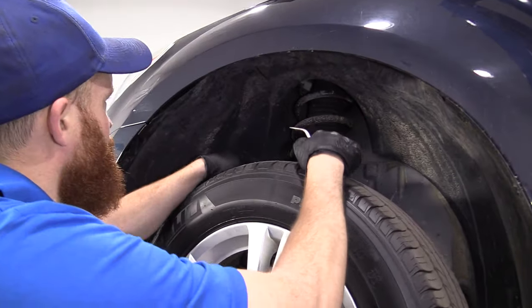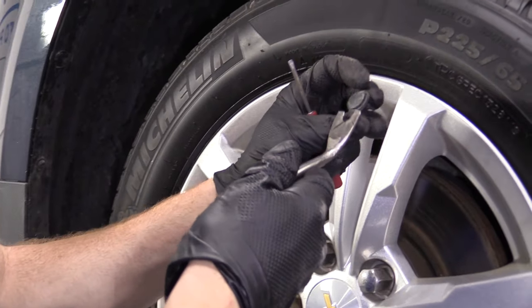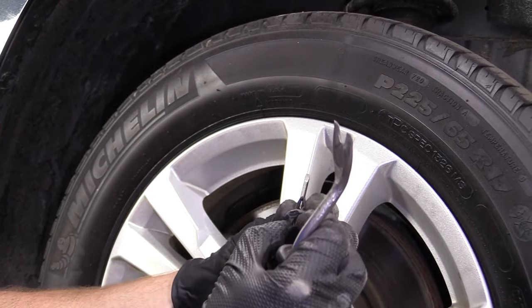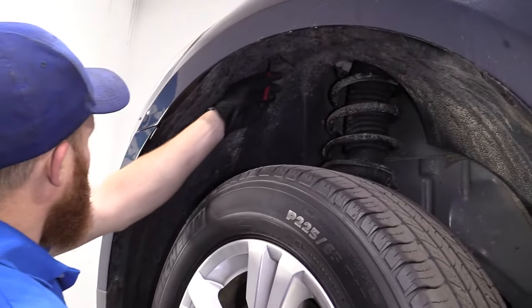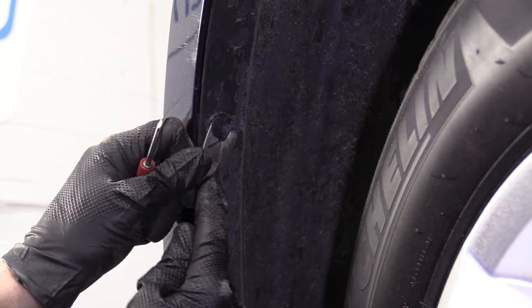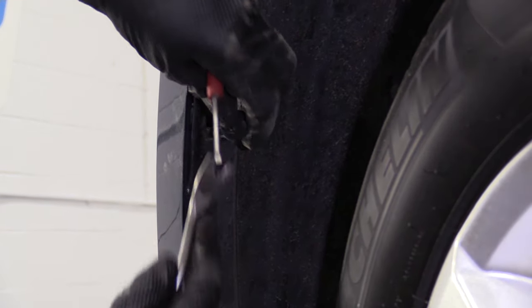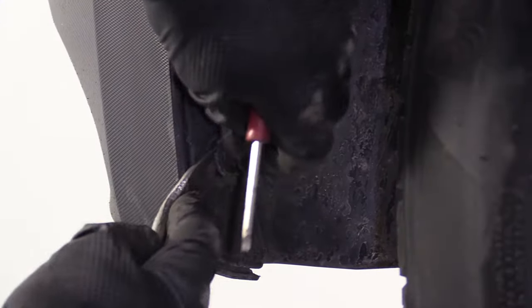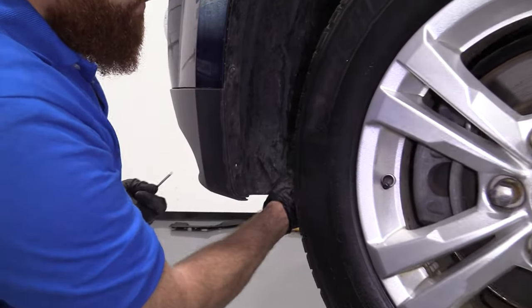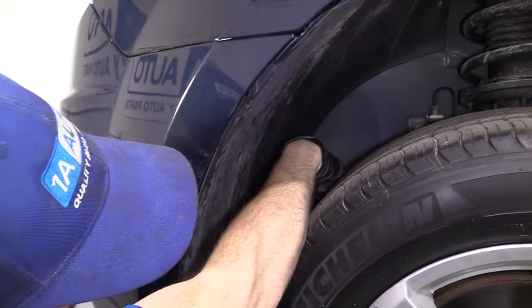I've got my little forky tool and a pocket screwdriver. Just going to try to pull out the centers of these push clips. When it was closed it was like that — I just go in between, pull out the center, and then it unlocks the little edges. We're going to move down the line. This one's going to be a little harder to get to because of the tire, but I'm sure it can be done.